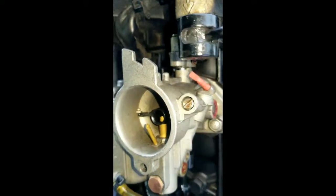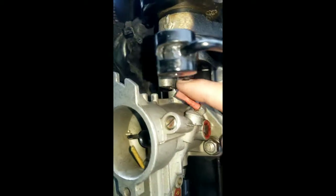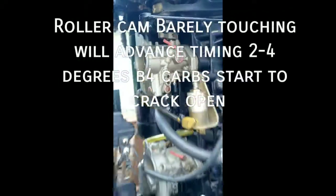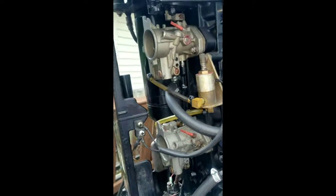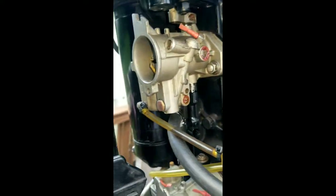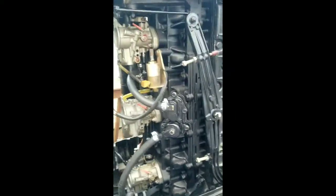And then lastly, once you get your idle set, your stop set, your MaxSpark set, and your primary set, you can go back and loosen this screw to get that roller cam to just barely rest against it. From there, all you've got to do is get on the water and play with the adjustments. I did do a video on that if you need help — it's actually not as hard as they make it. You just got to be able to listen and watch. That's pretty much all I got for you. If you have any questions, just put it in the comments. Thanks for watching.